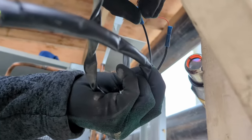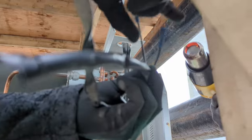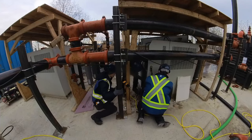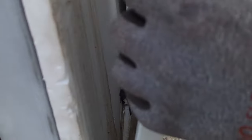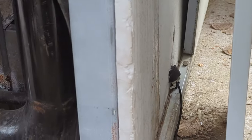But look at all this moisture coming out of these connections — that water is flying out. That is definitely the cause of our problem. So we redid all of the wire connections and heat-shrank it to make it waterproof, then put the system back together. It's very tricky — there are a couple of hidden screws that are really difficult to get to, but we got it.